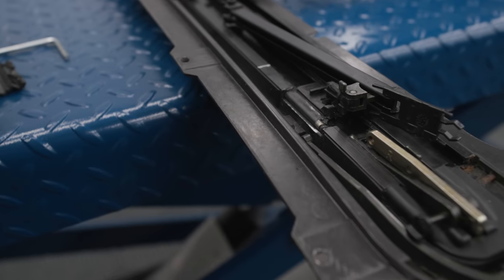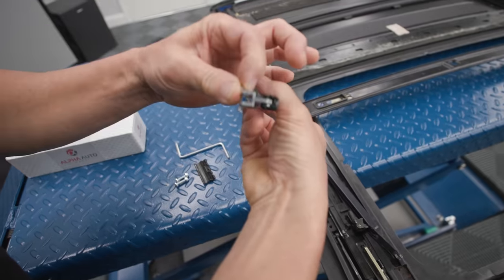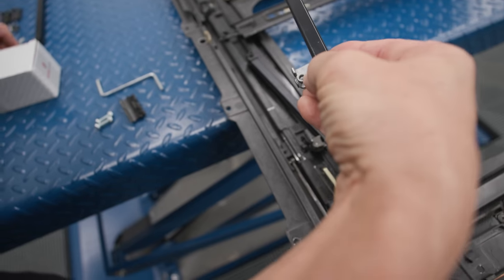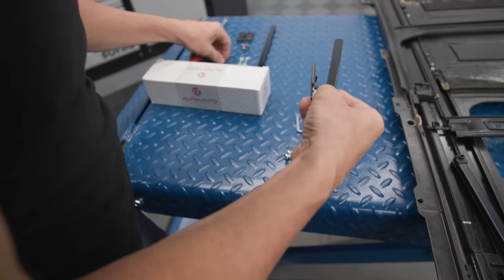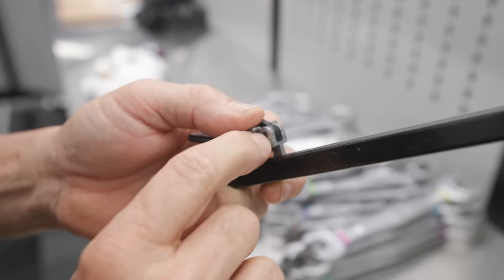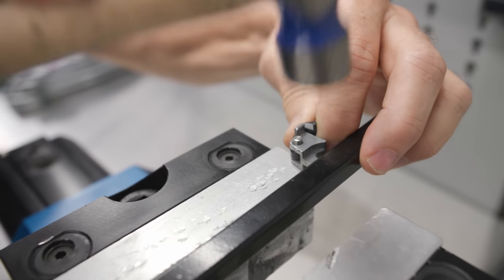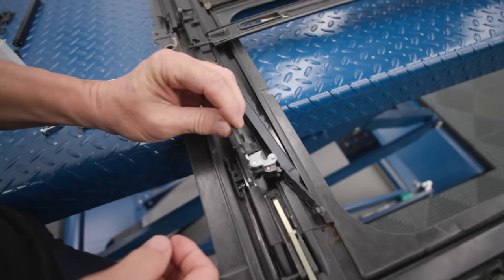So what I think I'm going to do is assemble this thing off the car. This goes on this way, back through here like that. Then this plastic piece goes here, and there's this pin that comes with the kit. This pin goes through and holds it all together. The hole diameter is larger on one end and smaller on the other - that knurled end goes in and kind of locks the pin. So now we've got that pin in there.